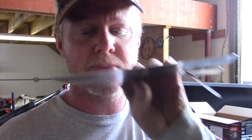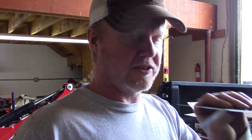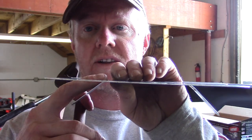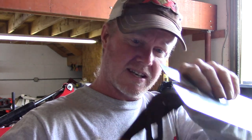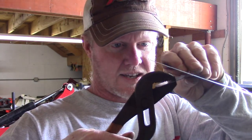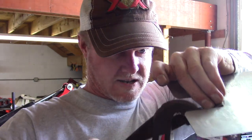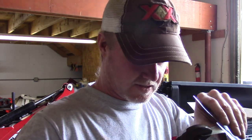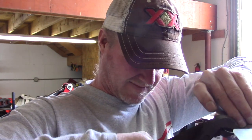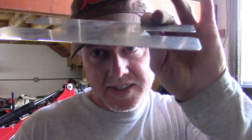Best way to do it is just bend it down at 45 as best you can. I do a push-pull motion because my channel locks won't get all the way to this edge, but that's where I want it to bend. And then I'm going to come back in with the channel locks. Just stare at it from the side, and you want about a half inch or so of clearance, like so. So hopefully that makes sense.